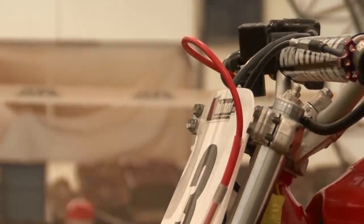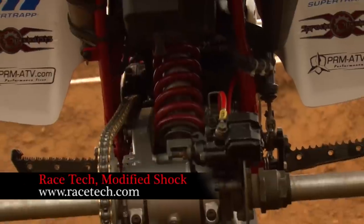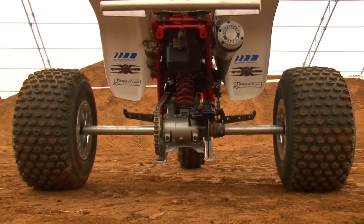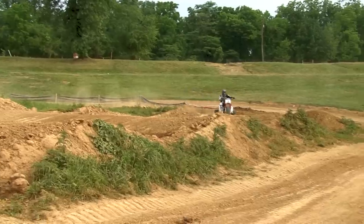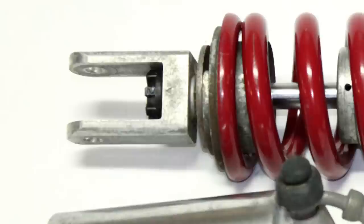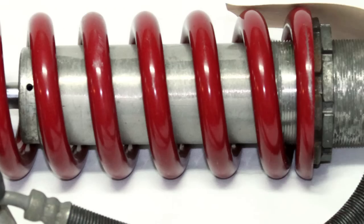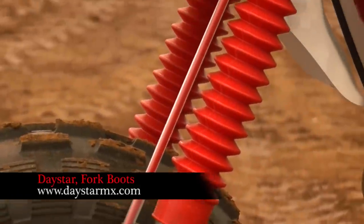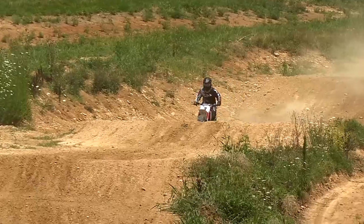After an initial break-in ride, we switched over to 20-weight fork oil set at 5.5 inches from the top of the tube to slow rebound damping a bit. Racetech's Todd Davis tells us that the stock rear shock's short stroke, high leverage ratio, and linkageless design require stiffer settings in the initial part of the travel in order to work best. Racetech replaced the stock piston with their gold valve, which allows unrestricted oil flow at the piston. Their high-flow piston is said to eliminate mid-stroke harshness and puts all of the damping work on Racetech's custom-built shim stack. Finishing off the rear shock conversion, the undersprung stock spring was replaced with a 16-kilogram spring. To maximize reliability, we installed a set of Daystar fork boots, which keep grime and debris from getting near fork shafts and seals.